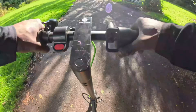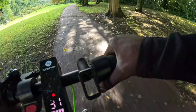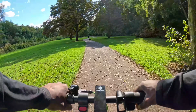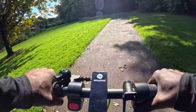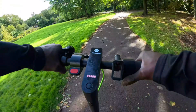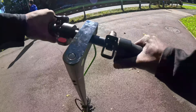This is the easy wheel — 350 watts or maybe 500 watts. Either way, I upgraded the controller with the shunt mod — I did not fit a new controller or anything like that. The shunt mod kind of doubles its power. To me it feels like double the power — this thing is incredible. 32 miles an hour! Brake check — I've only got the electronic brake because my manual brake does not work.